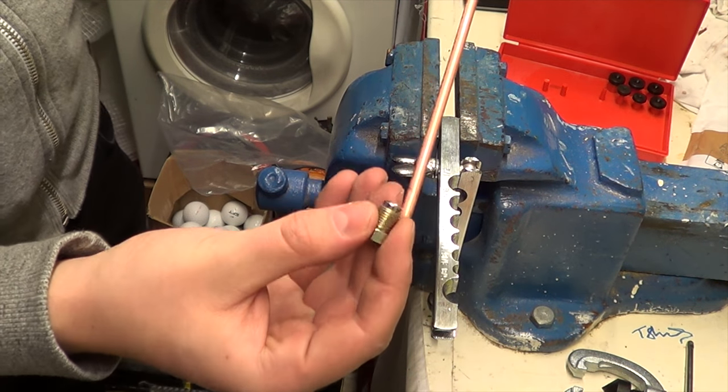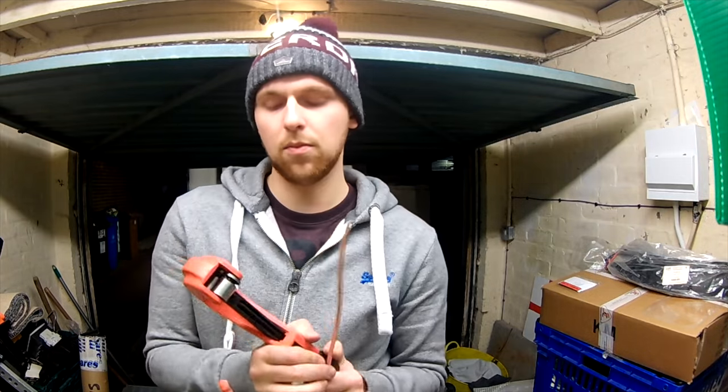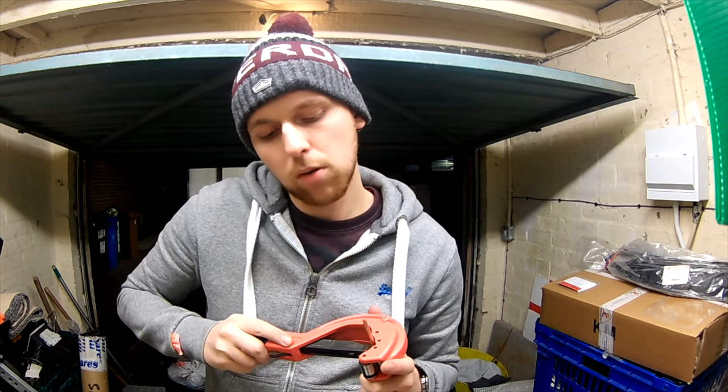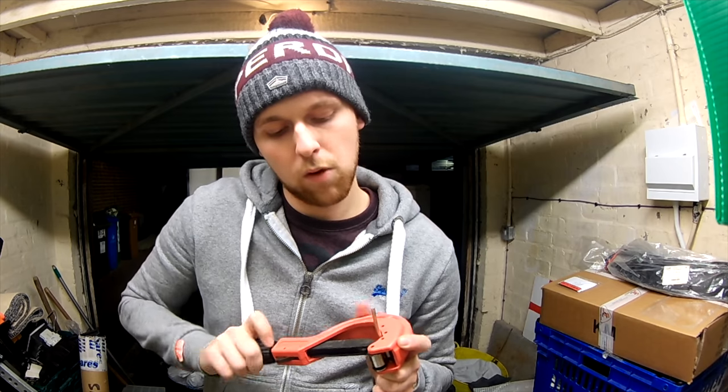I have just cut it temporarily — I'll show you how to cut it now. We need to slide the union on that way. You're going to use one of these — this is probably too big, you can get smaller ones for about a couple of quid on eBay. Don't use a hacksaw doing this because you'll get all sharp edges and it'll ruin the brake system.